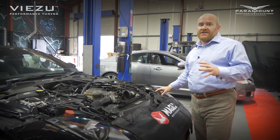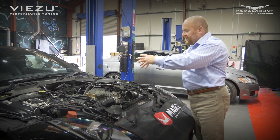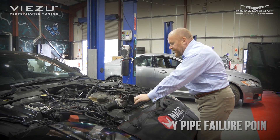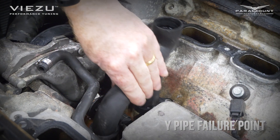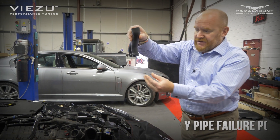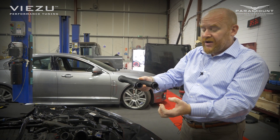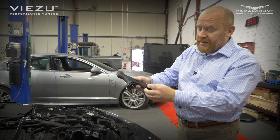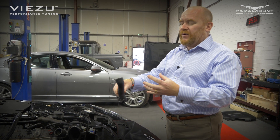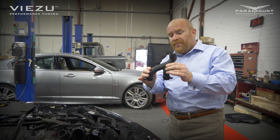Andy's been really busy for the last couple of hours and he's now got the supercharger off. This gives me a great opportunity to show you literally into the valley of where the supercharger lives and some of these pipes that fail. So come around and take a look — this is the Y-pipe. This is the pipe that classically fails, and I've got the new part here. As it's fitted down into the engine, these ends here actually normally completely break off. Sometimes they'll just split a little bit, but we've seen them quite often where this pipe completely breaks off. You can't see this leaking when the supercharger's on, so it's very difficult to see where they're leaking from. That is the classic Y-pipe part that fails.